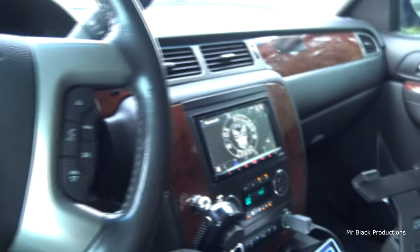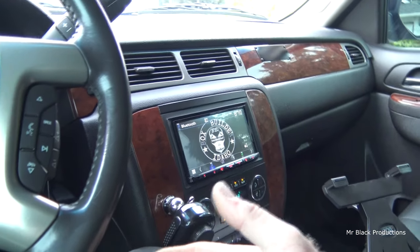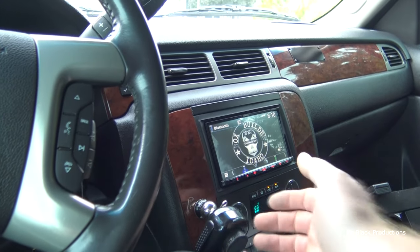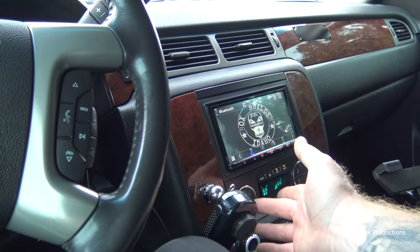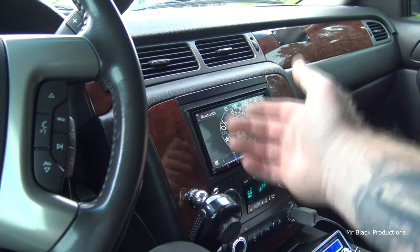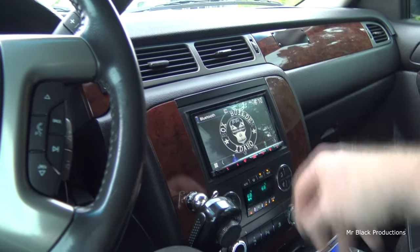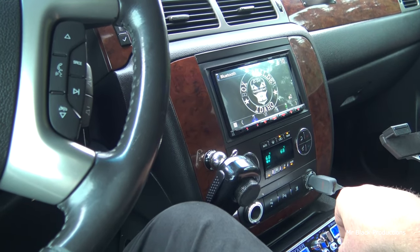That's that speaker, and it's down here. I ended up installing it down here in the kick. I don't know if you guys can see it or not. I disconnected the powered portion of the speaker. I couldn't get it to work in a high RF environment to where it wouldn't feed back. Let's turn the fan down even a little bit more. So I ended up bypassing it, and this is just the radio straight into the speaker.